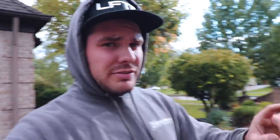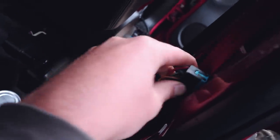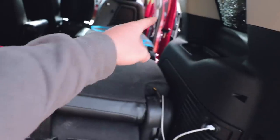Yes, it is cold. The sun is coming out again — finally. Let's hope the rain holds off for us to finish this. Right behind your seatbelt actuator here is this plug. It's down and in here. We peel back our loom and here are our colors — twist both of the positives together and both of the negatives together, and run that to the positive and negative of that speaker wire.